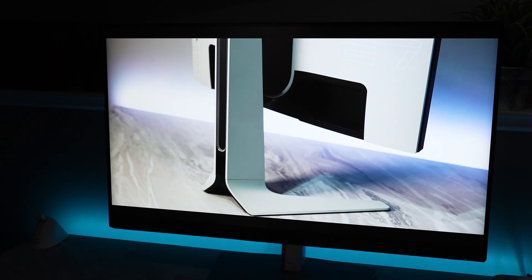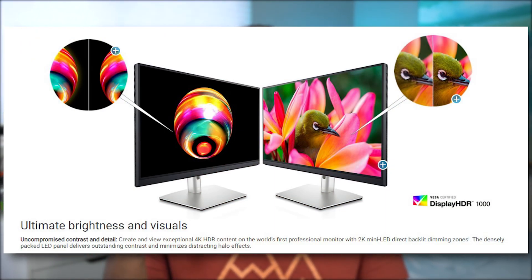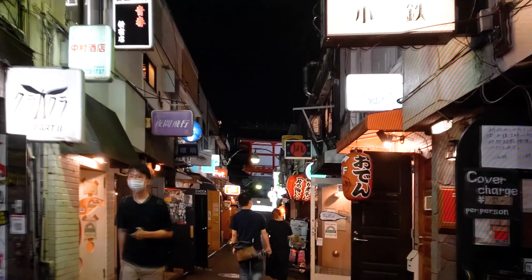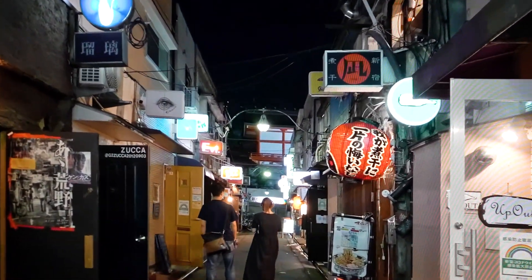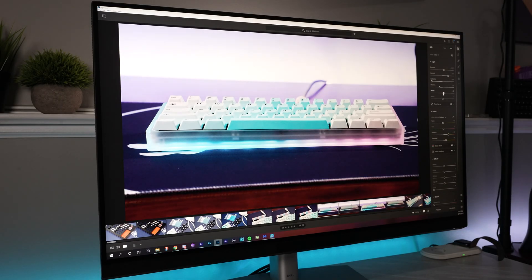As far as the content consumption experience goes, this HDR1000 is absolutely legit. This is probably the most true HDR1000 experience I've ever had. I don't think it's going to get much better than this unless looking at another display with very similar local dimming features, which not many do. In fact, this is the world's first display with 2,000 mini LED zones in a 32-inch panel. You can definitely tell the impact those zones have in terms of contrast ratios — looking at the brightest and darkest parts of the screen simultaneously, it's a night and day difference in how much detail you can retain in both light and dark areas.